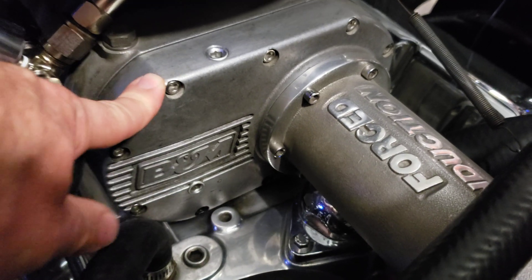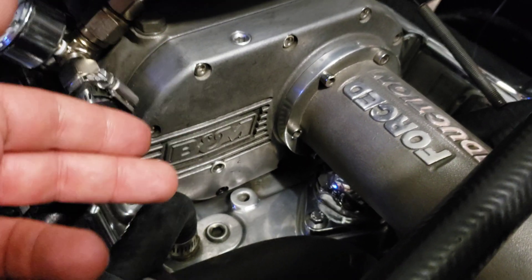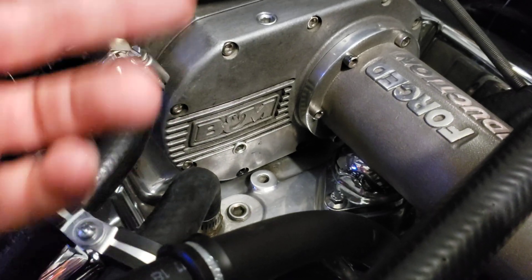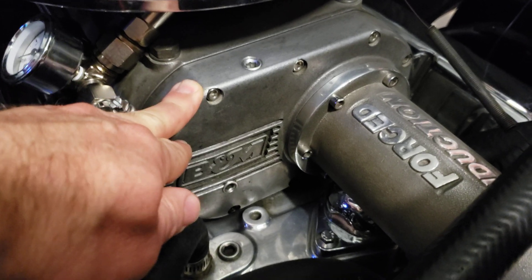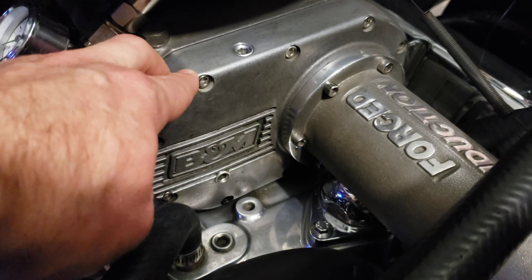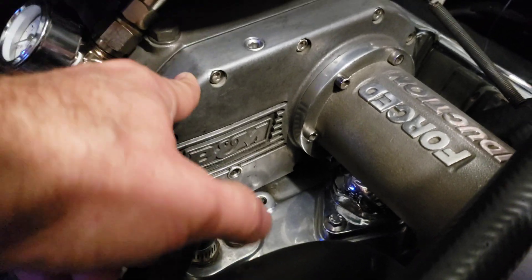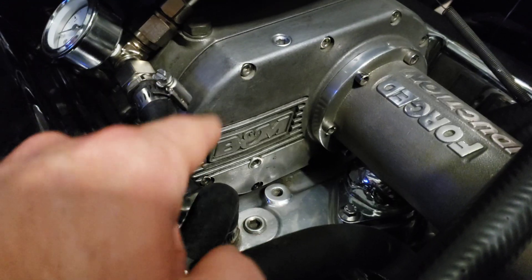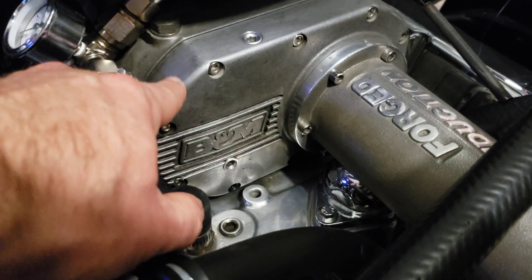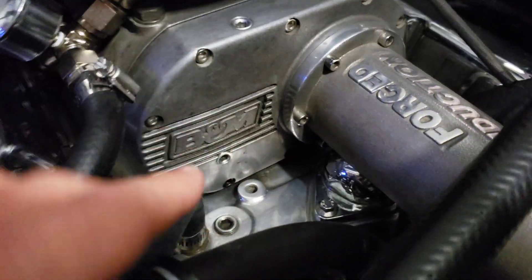You use a good quality gear oil. Some will say SAE 70, some will say SAE 80 or SAE 90 — any of those will work. These gear housings are not that particular. I had just serviced my rear differential and had some leftover 75-90, so I just put 75-90 in here. Perfectly fine.